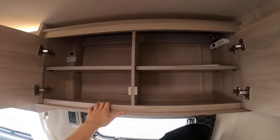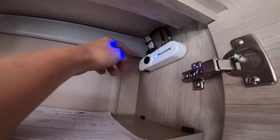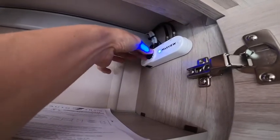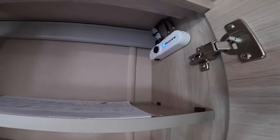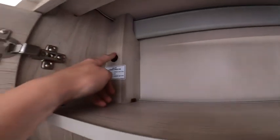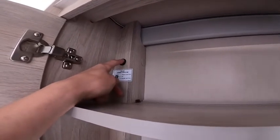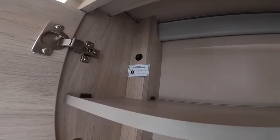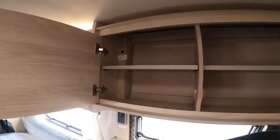Storage above the kitchen area. You have your TV aerial here - just leave it on, it'll go on and off with the main control panel. If you're struggling for a signal you can use the black wheel to boost the signal or drop it down if the picture is pixelating, to get the perfect picture as it's a fixed aerial. There's also a little switch for your solar panel charge selector: at the top it goes to the vehicle battery, at the bottom to the leisure battery, and in the middle it's off. You can choose which battery receives the solar panel charge - if parked up you may want it going to the engine battery, if in use you may want it going to the leisure battery.